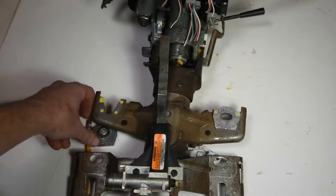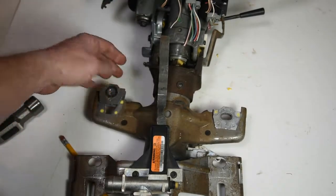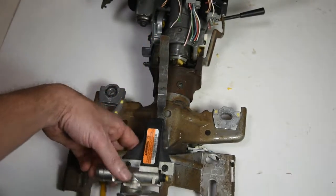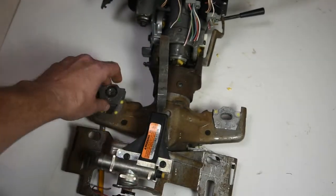So they made these aluminum pieces easier to slide out so it doesn't take a lot — you could probably bang the steering wheel really hard and knock these out if it weren't for this strap holding them in tight. When an accident occurs, the strap is released, so very little impact from the driver's body will knock these pieces out.